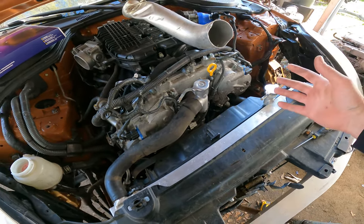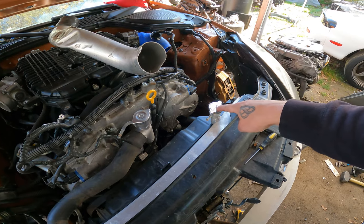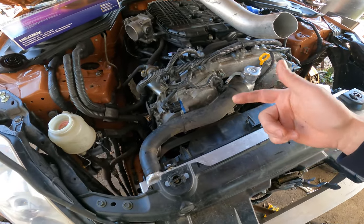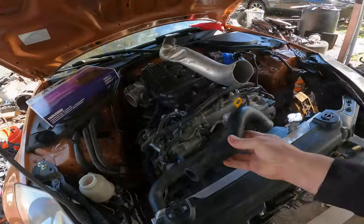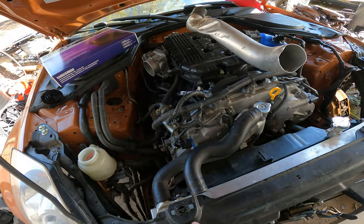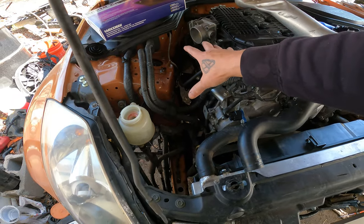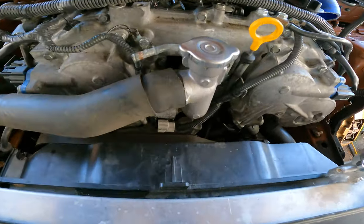Since this is going to be a track-only car, if the radiator works I'm just going to block this off and leave the hose where it is. If it doesn't work, I'll take the radiator to a shop and get them to cut the outlet off and weld it over here - that's where it needs to be for the HR setup. If you want to run factory air boxes, there's no way your DE radiator will work as-is.